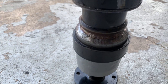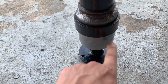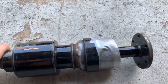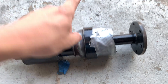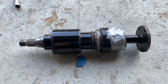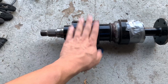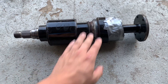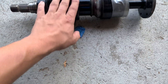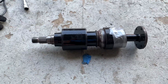I ended up getting the freewheel mechanism all welded up. He did three passes with the TIG welder and it came out perfect. I didn't realize how well he was going to seal it, so I probably didn't really need to drill the hole and drain the oil, but it is what it is. I'm going to clean it all with brake cleaner, make sure all the oil is out. After that I'm taking it to my local machine shop to have them balance it for high speed pulls.